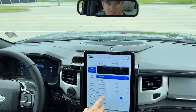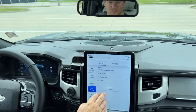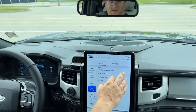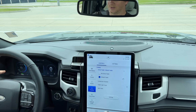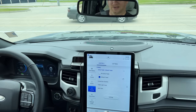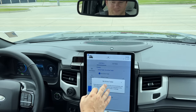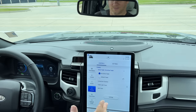I've got the trailer hooked up. I'm going to leave it in normal mode for now with one-pedal driving still on. Under towing I have not selected a trailer. Right now it shows 250 miles of range. If I select the default trailer it automatically changes our range — it says 125 miles, essentially dividing that in half. That's a good estimate. If you're pulling a trailer with a normal truck and it decreases your range by half, it's going to do that in this truck as well. I'm going with no trailer active because I want to actually watch the range decrease as we're driving.